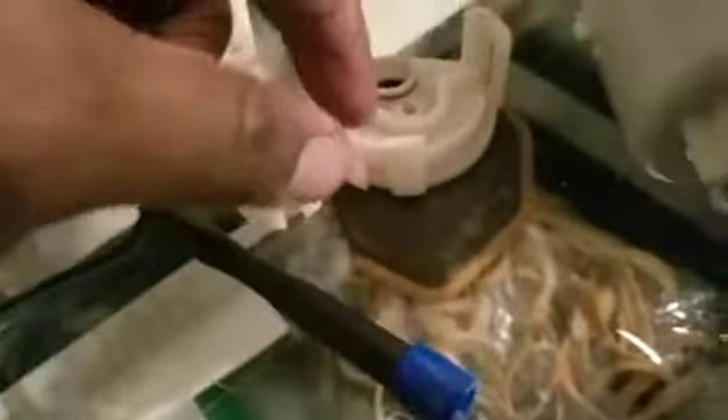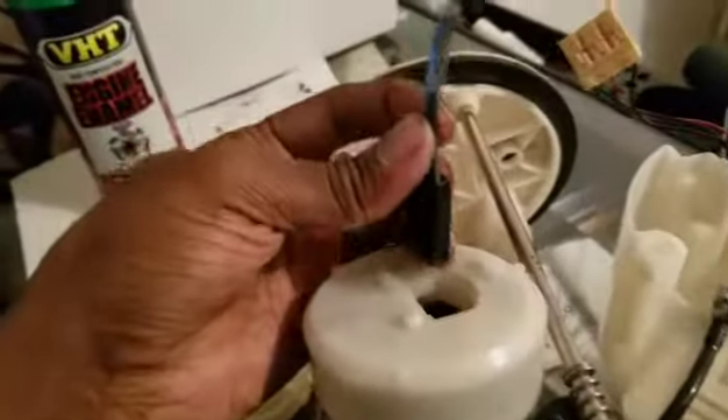I removed the bottom half — it was a bunch of clips, so be careful. These are some pretty thick clips, so take a prying tool like a really small flat head and get in between them and gently pry. Basically, the part came from here. Next, disconnect the wiring — this black wiring right here. Pull the clip from the black side, pull it out. Now you should be able to disconnect your whole old fuel pump.